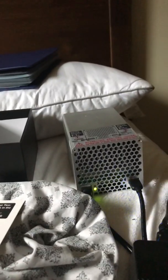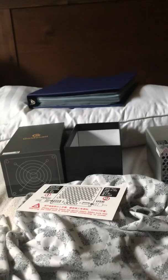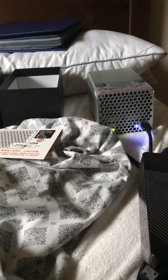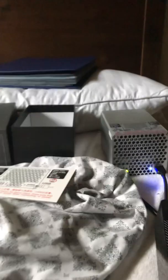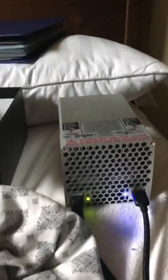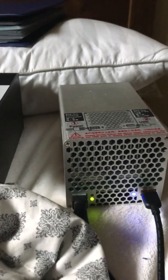Like it says on the instructions, you plug in the power, then you plug in the USB to the computer. At that time you plug the USB in, the fan's going to rev up super high, and that'll let you know that everything's hooked up properly but that it's not mining. So if it ever stops mining, you'll hear the fan rev. If you check on it and hear the fan at the highest rev possible, you know it's not mining. The fan is at top speed whenever it's not under load, and when it is under load you can barely hear it — the lights are flashing, the fan's going. That's as loud as it gets.